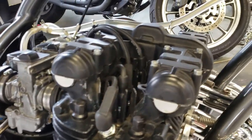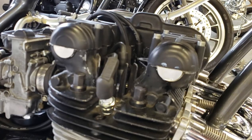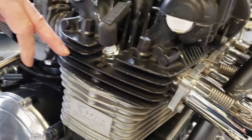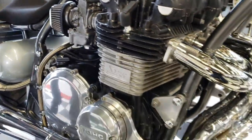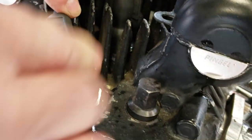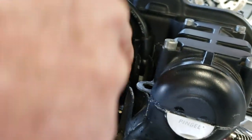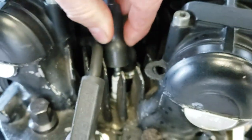But the head on this thing is really special, too. It's an 8-plug head. What's the scoop with that? Well, four extra plugs. You get a better burn. It's got a high compression engine, so basically, how do you do that? Like a machinist has to obviously machine. Yeah, you can see it right here. See these small plugs? Well, that would be the original. See the small one? That's just line bored, and then they bore the one in the back here. Four more plugs. A good machine shop can do that for you.